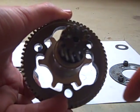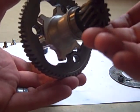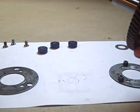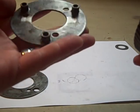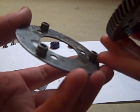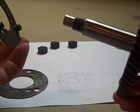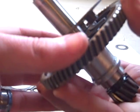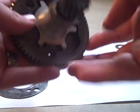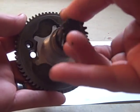That'll become more apparent when you see the pucks go in because they're a pretty tight fit. So we'll put the back plate on — the back plate or front plate, I'm not sure the proper terminology, but it has these studs and goes towards the first gear on the threaded side. Stick that in — there are holes there for the studs — slide in nice and smooth.